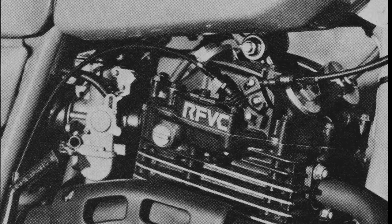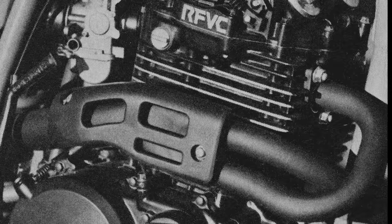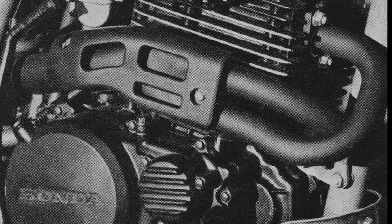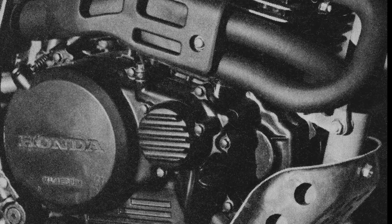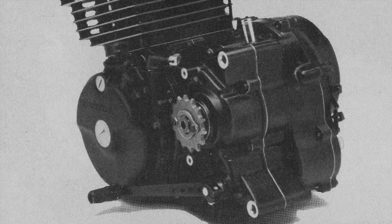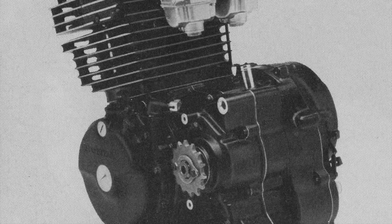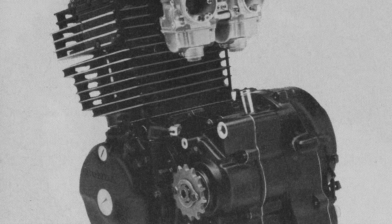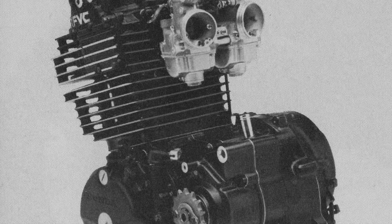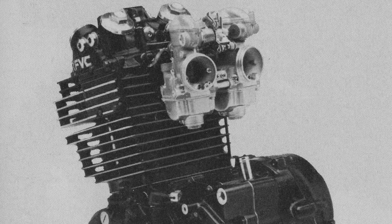This engine is air-cooled — there's no liquid cooling. One significant difference between the 350 and the 500 is that the 350 this year is a wet sump engine, meaning it carries all of its oil inside the engine. This would turn out to be an issue, because it caused the motor to run very hot. The 500 actually had a dry sump design, carrying its oil in a remote tank, allowing greater oil capacity and giving the hot oil somewhere to cool as it circulates through the frame. With all the oil carried inside the motor in an air-cooled engine, it wasn't easy to cool. So this first couple of years, the 350 suffered from overheating issues that led to some valve failures, oil thinning, and floating valves. There were reliability issues if you tried to run them really hard.